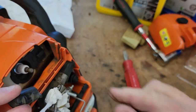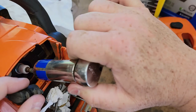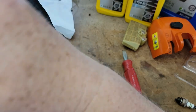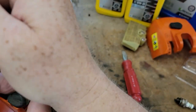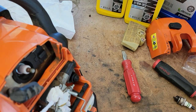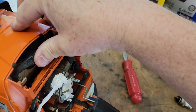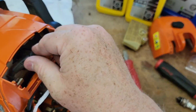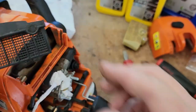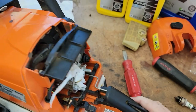I've got it to where it stops. Now we're going to put it on with the ratchet. Make sure your socket's all the way on it. I've got to crush that washer — right there, it stops. Spark plug is in. Now we're just going to put the electrode wire back on. You should feel it kind of grab and go all the way down — there, it's all the way on. We're going to put this piece back on. It's still dirty, we're going to clean it up. This piece just slides right in those grooves.